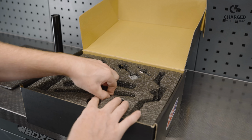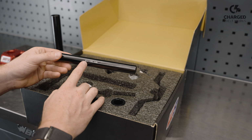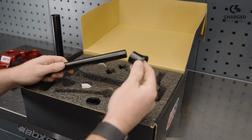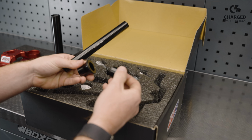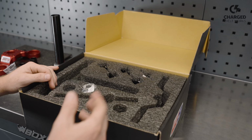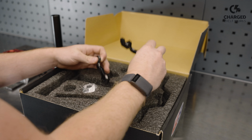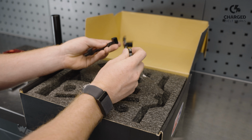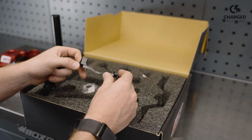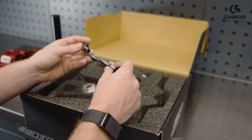From there, we have got a new axle. This is a much longer axle. It fits perfectly into your ALX13RC FastAce front forks. And then you've also got widening wheel spacers to go into your front wheel to make it fit the fitment of this wider axle. Something super unique that Warp 9 has provided is a 37mm and a 17mm brake adapter for this fork. So it steps it out wider, but the 17mm is used for a 220 rotor. The 37mm is used for a 240 rotor.